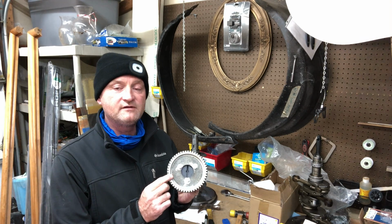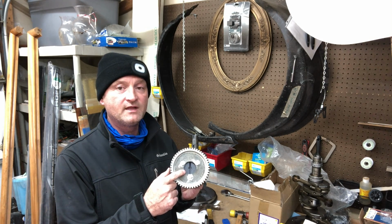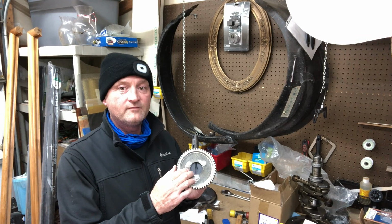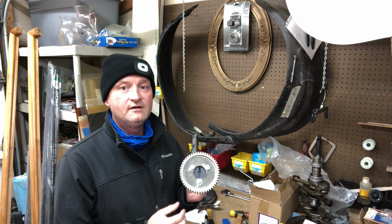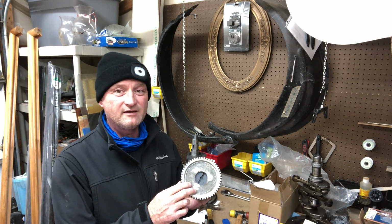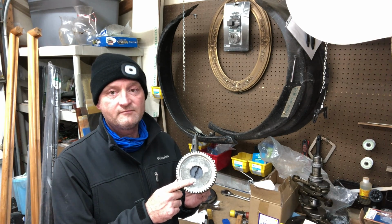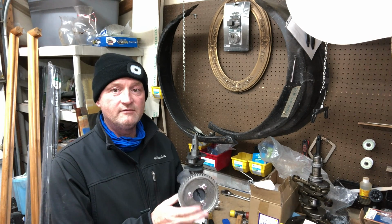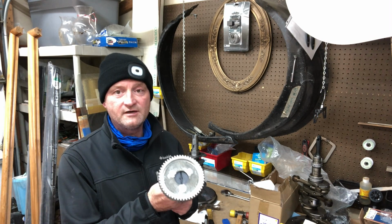These bolts came with the camshaft, and they're fine probably, but they have these little button type ones because your oil pump, the drive for the oil pump goes in this little groove here. So you've got a clearance issue with the bolts and the oil pump. So that being said, I think I'm going to wait till that new gear and the other comes. That way, in case this one's too tight or whatever, I can switch them out. And either way, I'm definitely going to use the other bolts. They're a little hex head thing with a little button on top instead of the big bolt. I just don't want to have any torment that way. I did clearance this out for these bolts, but I just think the others will be better.